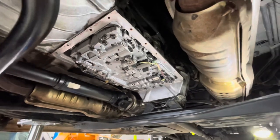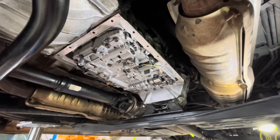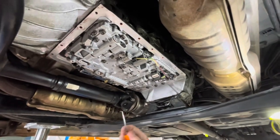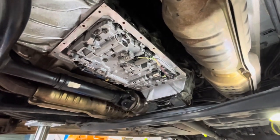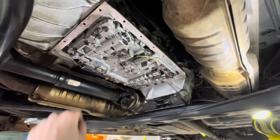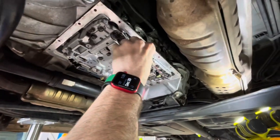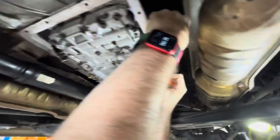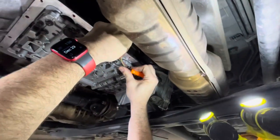What we're doing right now is the shift lock solenoid — that would be this one right up here. It's not one of the easy ones to get to. After you clean up all the transmission fluid dripping, you pop out some of these clips to get them out of the way so you can drop the valve body. This one's a bit of a pain — you've got to kind of push it in and move it up.